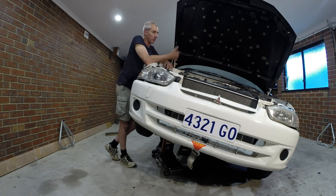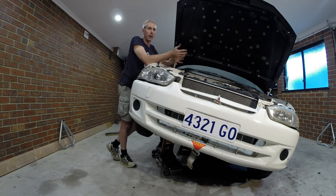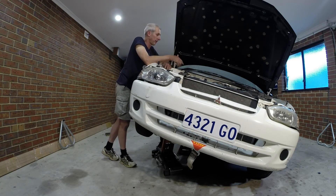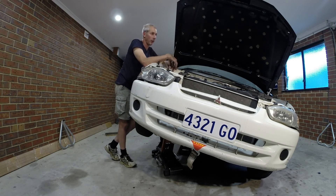In every scenario I've tried opening and closing the doors, and they all close and open beautifully, so there's not that much flex in the car - it's a stiff shell from the factory. There is some variation. Take into account that when you're going into a corner, you might have more loads on the bottom than on the top, so there may be a variation in that which I can't measure in this sort of scenario, unless I was doing live testing out on the track.